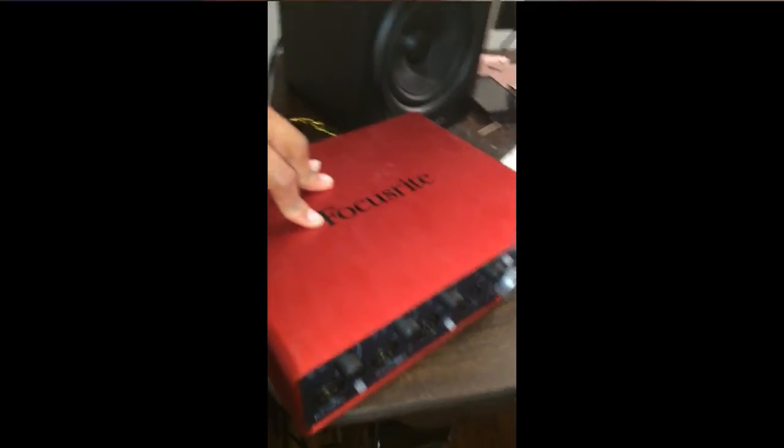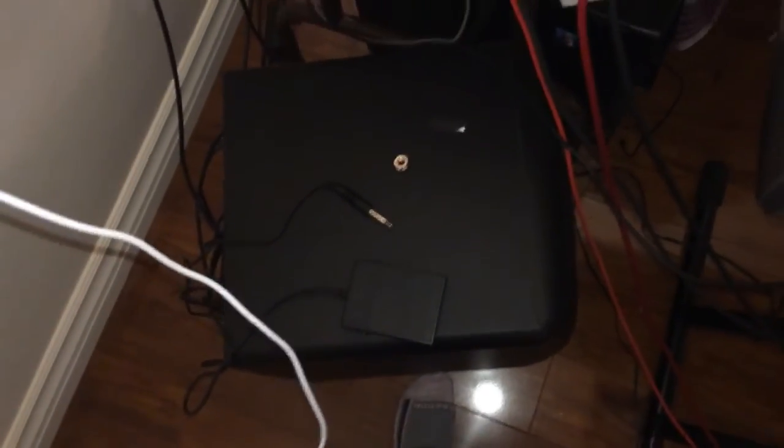And then hit record. So on the back of your subwoofer, right here I got a pedal. This is just a Yamaha pedal or whatever, a 1/4-inch cable, and it goes down here in the back of your subwoofer, and that's a bypass basically, so your subwoofer doesn't come on. You know, you got some neighbors, it's 3 in the morning, you got your speakers on, you don't want the bass cranking, you put that in, and then if you want to activate the bass, you just push the pedal and that'll activate it for how you hear it. So this is a good thing to have, a pedal for the bypass.